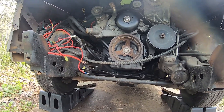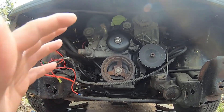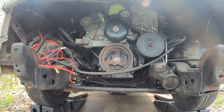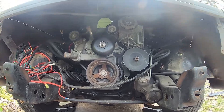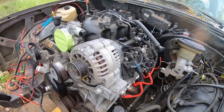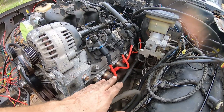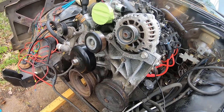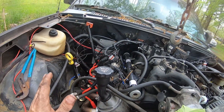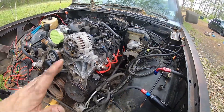So I need to go ahead and get the hood off so I can pull this motor out. There's a lot I have to do to get this thing out of here. I've got the headers disconnected at the collector on either side. I'm hoping I can just lift it up and out. This side looks like it has plenty of space. I may have to bump it over this way and then come up. I've got the transmission disconnected and the torque converter disconnected.